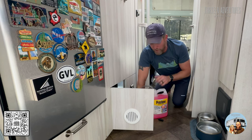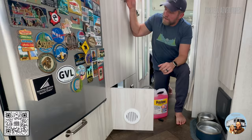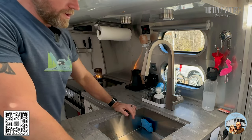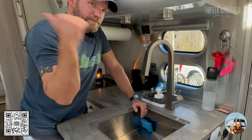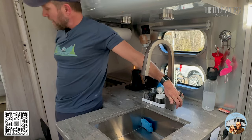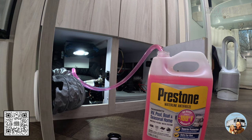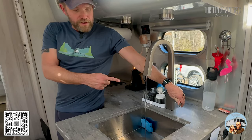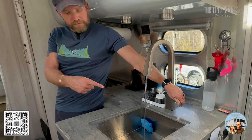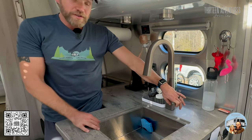In here is my winterization valve — there's still some pink fluid in there from when we winterized it a few days ago. This hose is going to go down inside the antifreeze tank. Pull off the cap — it just keeps the hose from leaking back out when stored. Down in here is a three-way valve, and right now the handle is in line with the water tubing. I'm going to turn it to be in line with the winterization tubing. I can winterize this whole trailer with one gallon of antifreeze — on most Airstreams, less than a gallon, probably three-quarters. Tube inserted, three-way valve turned. I'm going to go to the cold water first, starting at the spigot farthest from the water pump. It's going to take the longest. I turn it on and watch the tube sucking through — it gets a little air first, then eventually turns pink. And there it is — the slushie is pink. Cold is good.